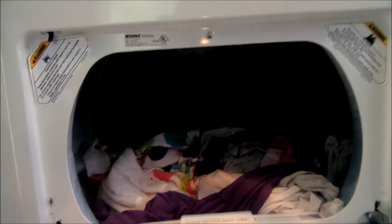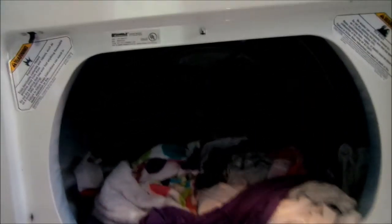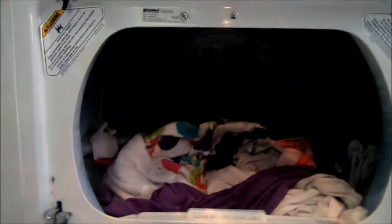So it's probably going to be the heat element or that high limit thermostat on the heat element. How much clothes do you put in? I would say halfway is good. The machine was designed to run efficiently on a certain amount of clothes — there should be a poundage rating on your particular model, but half full is most efficient. Always check your lint filter each load.